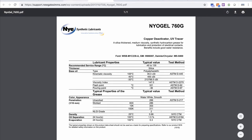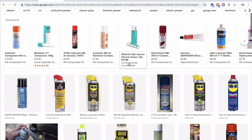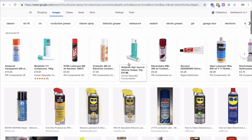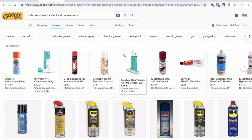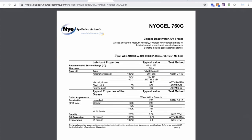We don't recommend the use of silicone. There are a lot of retail contact sprays that are silicone based out there. We and our partners at Nye Lubricants do not recommend silicones for electrical applications for a number of reasons. Primarily, we sell our 760G to a number of automotive companies — they don't allow silicones in their assembly plants, as silicones have a fantastic ability to migrate and can easily contaminate around the factory, most notably in paint shops. Secondly, in electrical applications silicones can polymerize into hard brittle material, which can cause electrical problems and sometimes weld connectors together. Decades of experience and the approval of most automotive suppliers and major manufacturers is the best evidence that this is a widely approved policy.